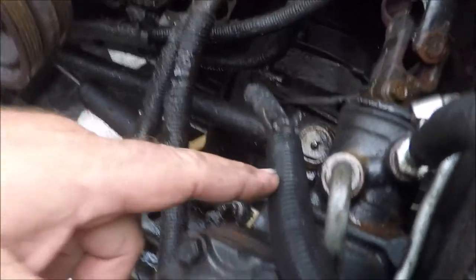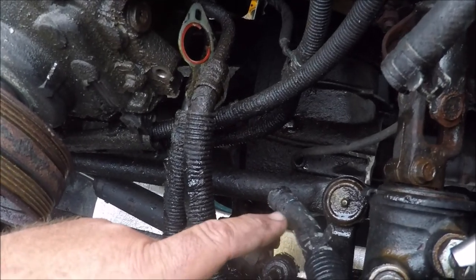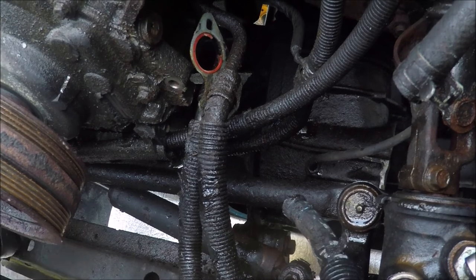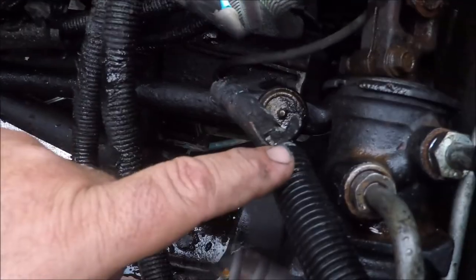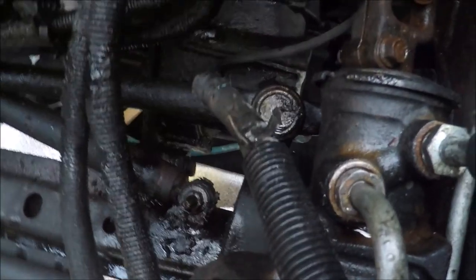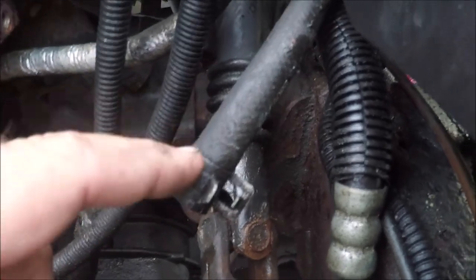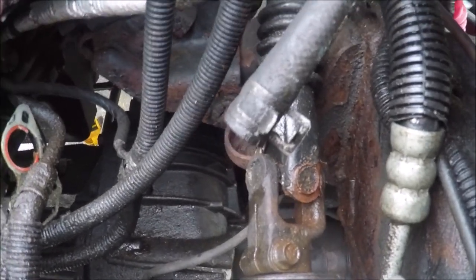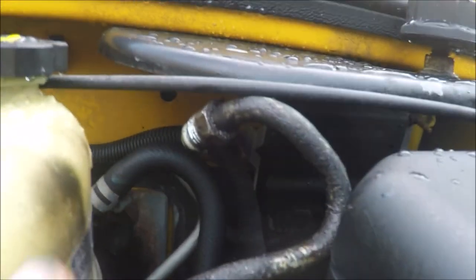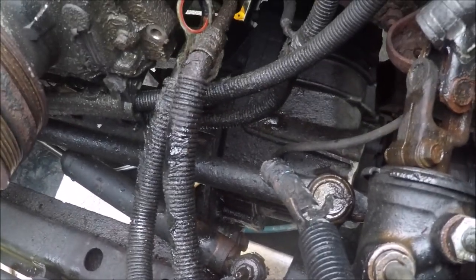Hold on, be on the tranny. Okay, for the power steering pump, this hose with a corrugated piece on here, wire loom, that might be aftermarket, goes to the lower portion of the... hold on. This does go to the lower fitting on the power steering pump itself. This hose right here that goes up to the hydro boost goes to the upper fitting on the power steering pump. And the third hose? The third hose we have wrapped up there. That's where we drained it. That's gonna come back down and screws into the bottom, and screws into the back of the power steering pump. Okay. That'll be it.